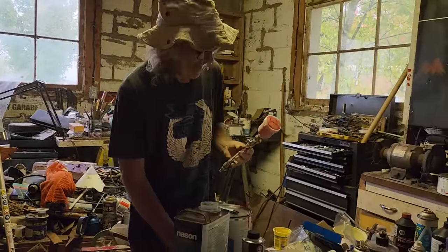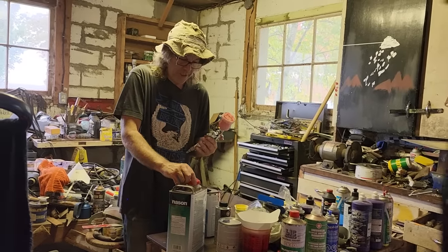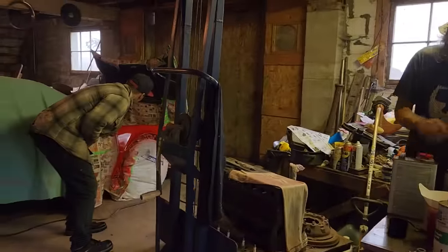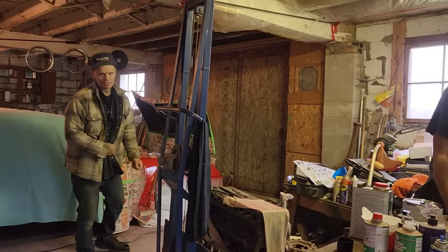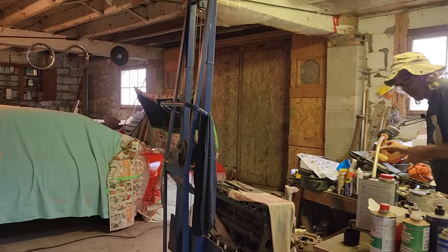Okay. You want to put more paint in it? Are you ready to rock and roll again? I think it's a little too dry, or not dry enough. This is how I would tell: touch the tape. Paint dries faster on the tape. It's not quite dry yet. You're right. It's slow, and I got medium, right? And your temperature is not.